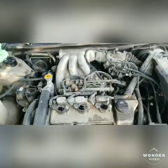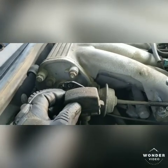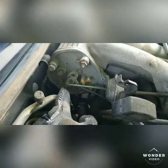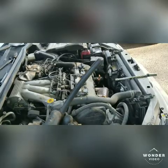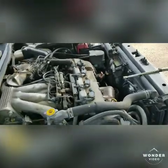On the back, it has a small window of opportunity for you to get back there with the coils. That's one — you can actually see that 10 millimeter bolt right there. And then on this side, I had to remove the diagnosis port, and also there's a negative ground that I removed in order to get to the coils back here. There's another one over there in the center. What has been a big help for me is a piece of rubber hose — putting your spark plug inside the hole and then threading it in with the hose first, so that way you don't cross-thread those spark plugs as you're putting them in.